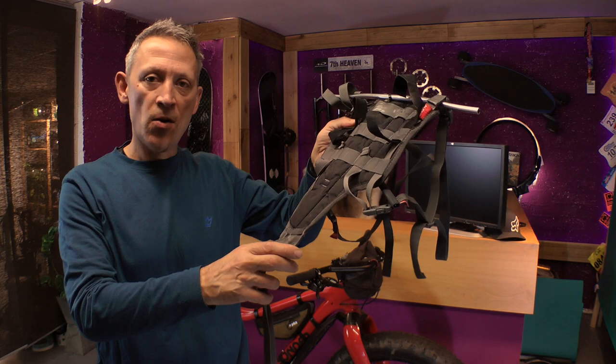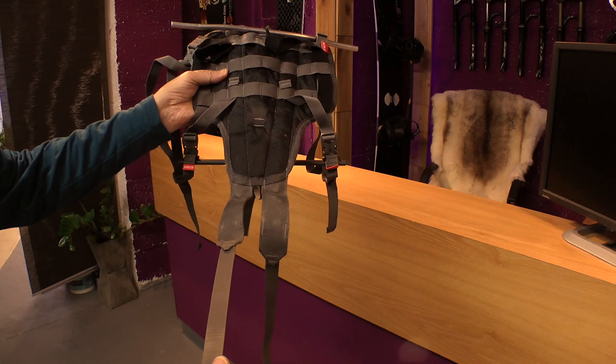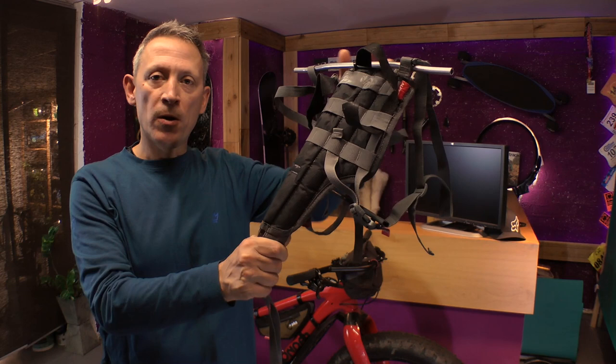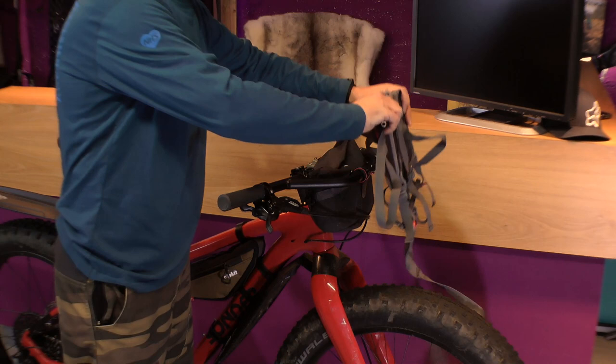To solve this second problem I have this — it's an Out Kit Kanga harness. What's unique about this harness compared to others I've seen is it has a couple of straps right at the bottom. This harness doesn't take the weight up here at the bow section of the handlebar — it takes the weight down here, where these straps wrap around the crown of your fork. It doesn't matter if it's a suspension fork or a rigid fork; these straps take the weight.